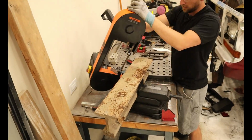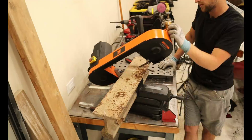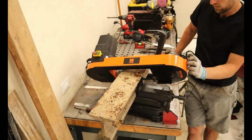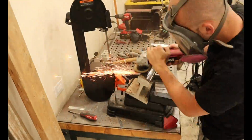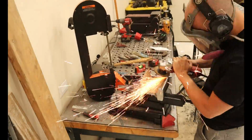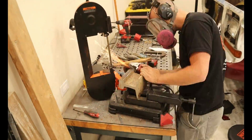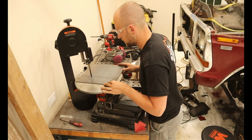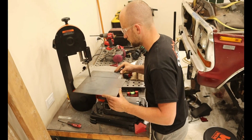I got this idea from Classic Car Studios out of St. Louis, Missouri. They use a piece of railroad track to shape metal. They cut off a chunk, shape it to size, and then take their piece of sheet metal and hammer and dolly it until they get the right curvatures. Since we have a template, that's exactly what we're going to do. And we need to first cut off a nice chunk that we can shape.